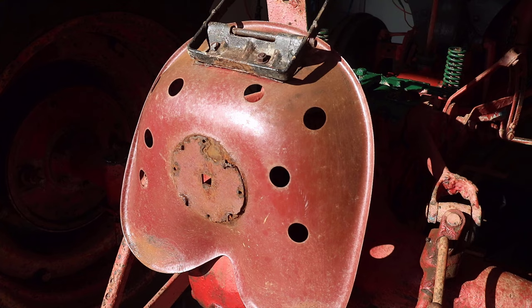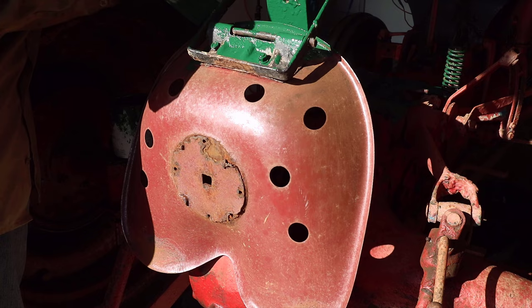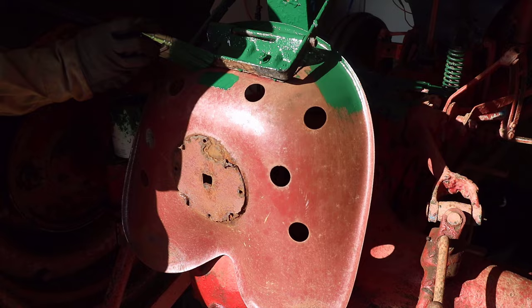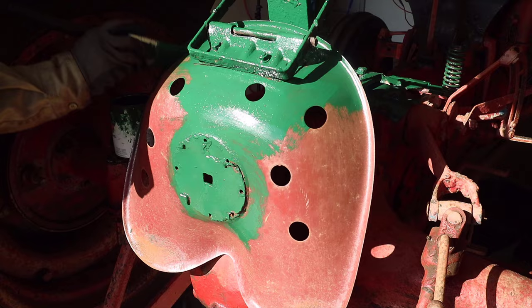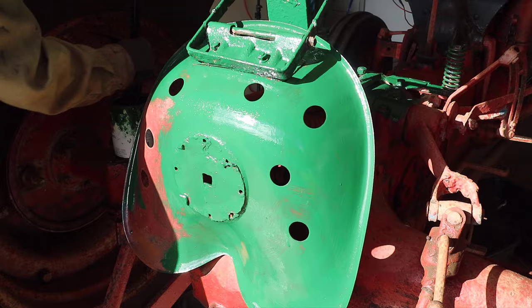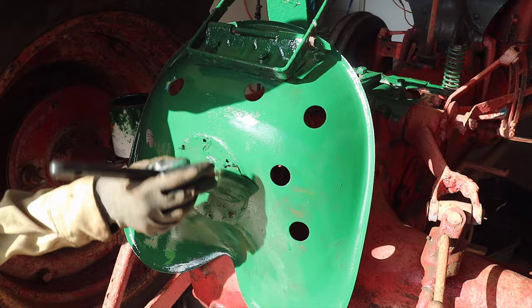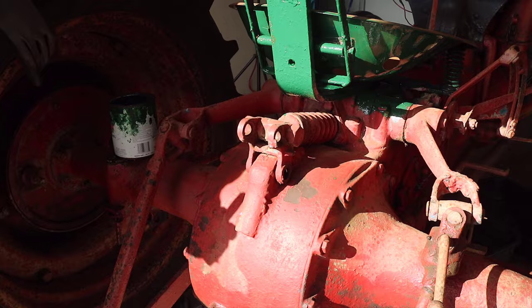The next area was the bottom of the seat itself. This was given next to no prep time except for a very quick sanding to have something for the paint to adhere to. Although this is not a proper paint job, it does accomplish a few things. The main priority was to help delay the rust while working on other parts of this project. Starting to knock off the surface rust could delay the spread. The paint job would also reduce contact with the rust, dirt, and oil, and serve as a reference point to identify active leaks versus old oil never cleaned off.